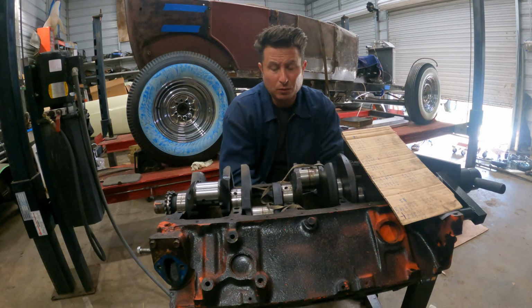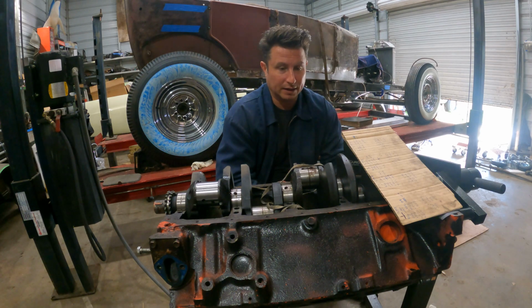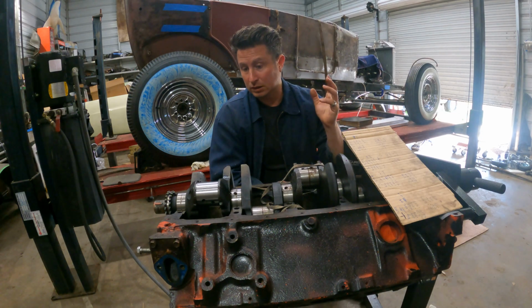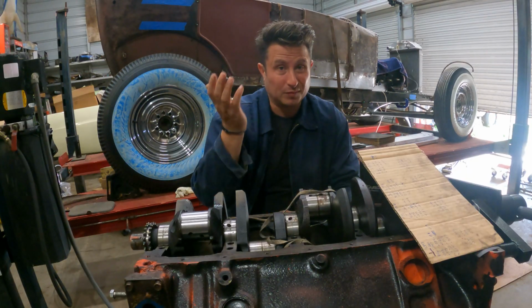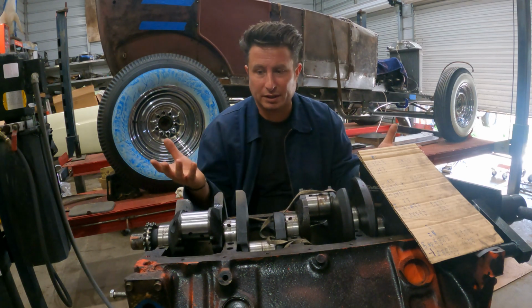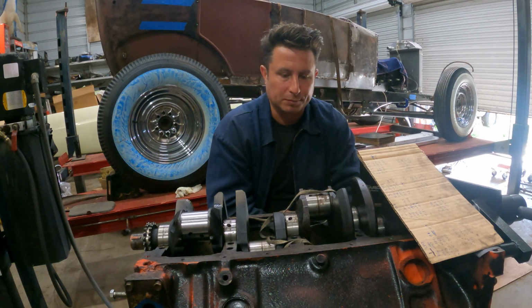So I will continue on this. That is the plan we are gonna go with. I'm gonna order some parts, and we're gonna see what happens when we get it together. Because at this point, once those parts are ordered, we basically have to start checking all the bearings for clearances. If those are incorrect, we'll have to order new bearings. We'll give it a hone, install the pistons. We gotta find a camshaft. That's kind of a, you know, little bit of a nightmare. But after that, we're just kind of reassembling. So the doldrums, the sort of difficult part of figuring out what the hell we're gonna do is, well, it's right here. It's where we're moving very, very, very slowly forward. But at least we know what we're doing now.